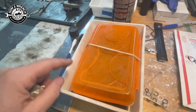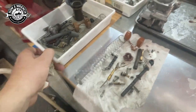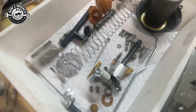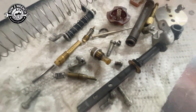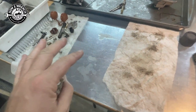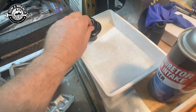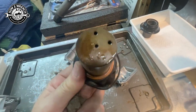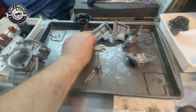I've drilled a bunch of little holes in the bin, which allows the ultrasonic fluid to get down in there and do its work — it does an amazing job. You can see ones that haven't been done yet, and here's a set that's been cleaned and is ready for installation. These are out of the cleaner but just need a fine clean, which is why I've got some little toothbrushes. That's a used slide — you can see how bad the dirty ones were; this one was actually torn, it looks like a hot mess.